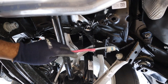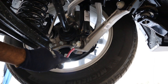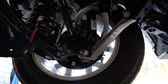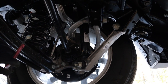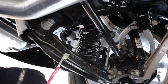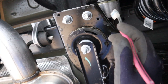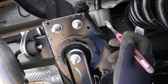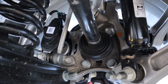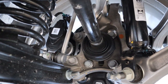Here's a look at the rear suspension from underneath with a better view of that stamped steel frame. You also have aluminum control arms with the shock mounting to them. These are just standard OEM shocks and springs. There's also a lower hydroformed control arm with a camber nut at the end to adjust camber. I like how Jeep is moving towards using aluminum for hang-on pieces like the sway bar bracket and the muffler bracket. Here's also a better look at the four bolts you'd have to remove to change the bearing on your knuckle.